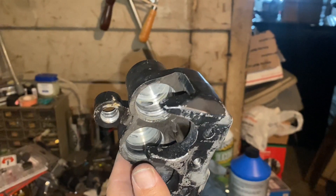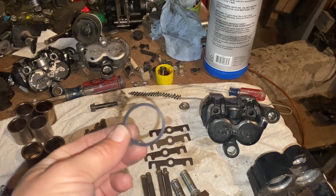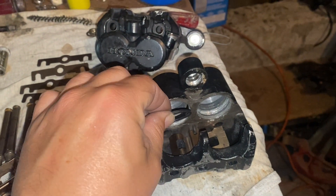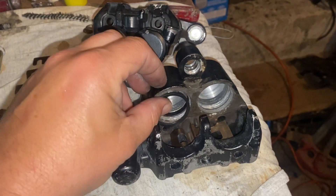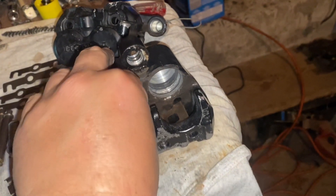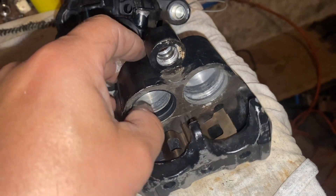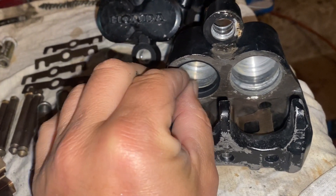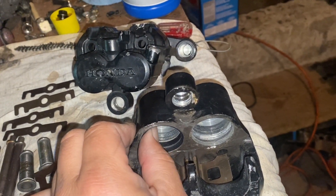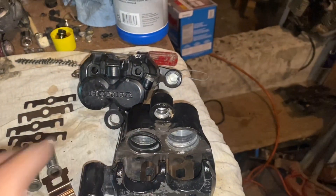It's built for this caliper. Your dust seal — same thing, they are thinner and have a little lip. Don't pinch it; fit it into one spot on the caliper first and then it'll easily drop into place. Don't force it — if you're forcing it there's probably dirt in there or something wrong, and you should address that first. Make sure you don't twist it — that's the biggest thing. If it doesn't fit in correctly you probably have dirt, so clean it out with a pick.